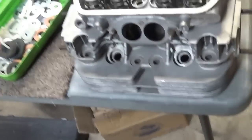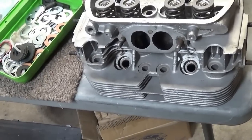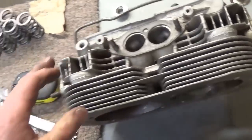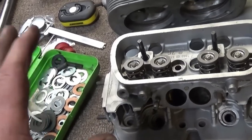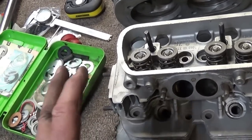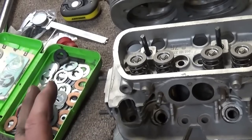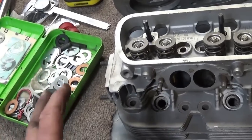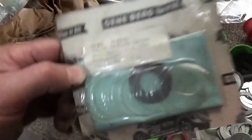These are the old heads that were on my two-liter, and that thing ran awesome. They're 62cc chambers and I've got 55 thousandths deck height, so I think I'm going to go with that rather than add spacers underneath my cylinders. I'll keep the deck height where it is and get the volume I need to arrive at about 8.5 to 1 compression, which is right in line with what the cam manufacturer suggested.